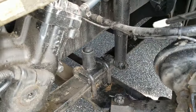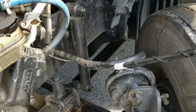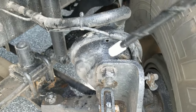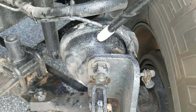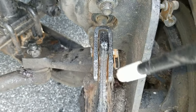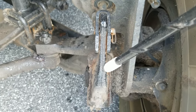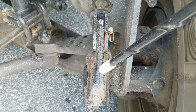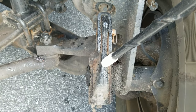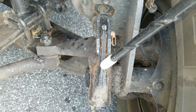I'll check my braking system. I'll check my air lines, make sure they're not cut, frayed or dry rotted, no signs of leaks, to my brake chamber. Make sure that it is securely mounted, no loose or missing bolts, it's not cracked, dented or leaking. I will check my push rod and slack adjuster. Make sure the push rod isn't bent or damaged, the slack adjuster has no loose or missing parts. I'll check the adjustment on it. With the brakes released, it should not pull more than one inch. One to two needs to be adjusted, over two out of service.